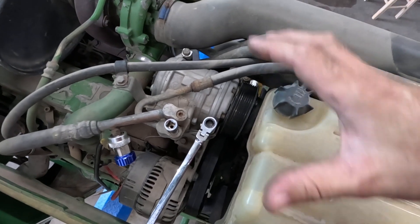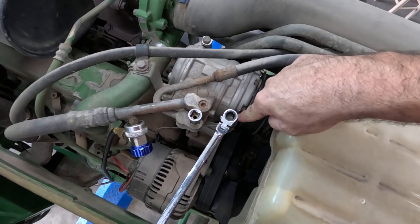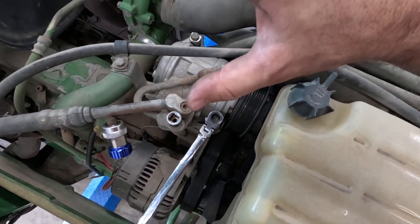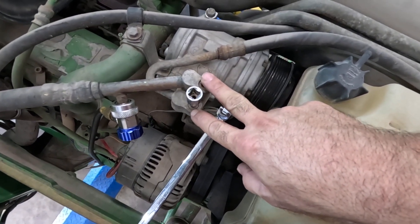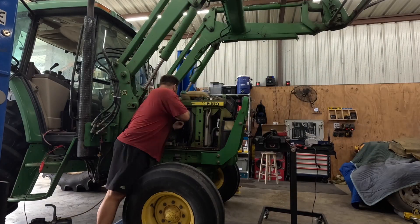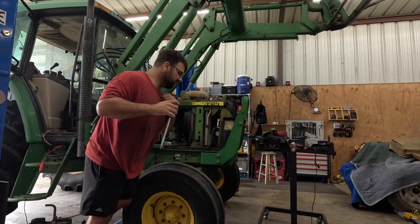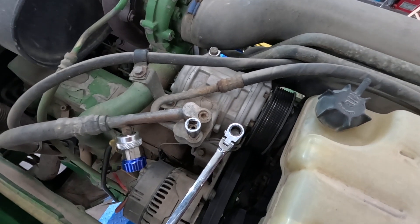Looking from the top of the engine compartment, what you've got to do is take off four 13 millimeter bolts. You've got this bracket on this one, but four 13 millimeter bolts and this will completely come up. In order to get the hoses off — the high and the low pressure lines — you've got to use a 6 millimeter metric hex bit. Once you've got the lines off of there, you can blow some air through there to see if there is flow, because I want to see if the condenser is clogged. If the condenser is clogged I might have to take it off, which is right up under there, and blow it out or replace it.